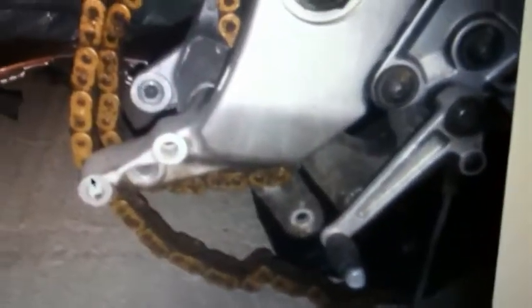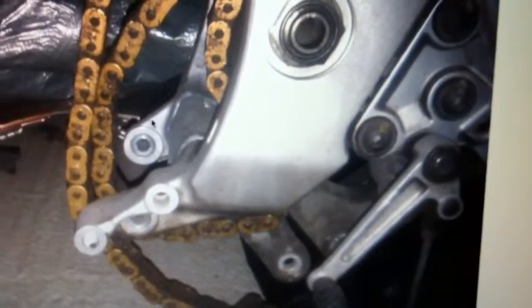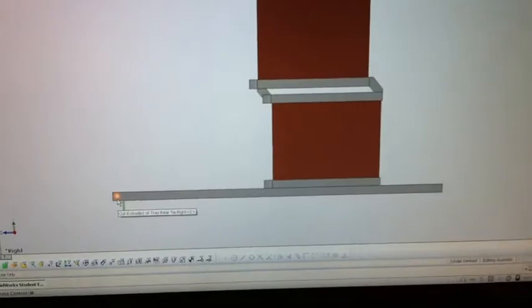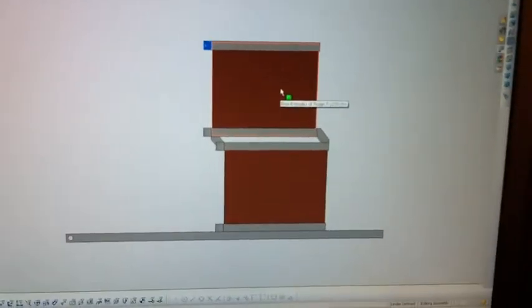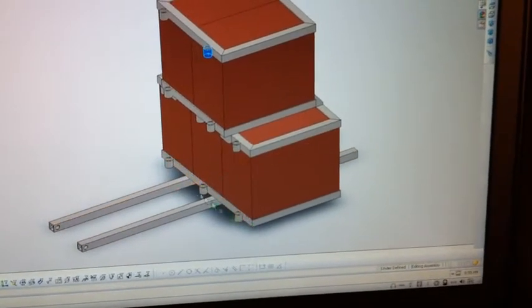You can see the pivot point in the lower mounting rail there. That'll get tied in to this bolt hole right there and there. That's the one we talked about with the long rod straight through. That's where it pivots on. So slip a temporary 8mm bolt through there, the threaded rod, and then put some spacers on there to prop this up so it's level, so you got something to work off of. And then sit the lower tray in place and the upper tray and align everything before you weld these 2 rails onto this lower tray right here.